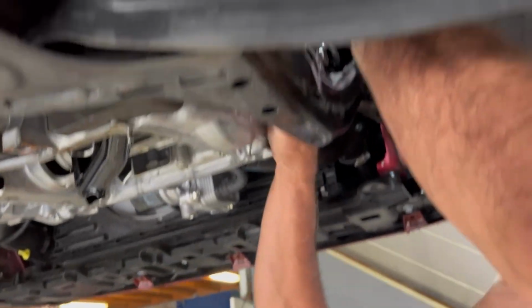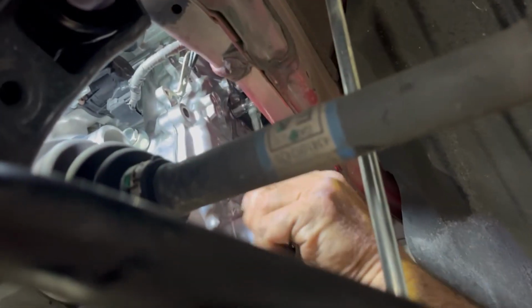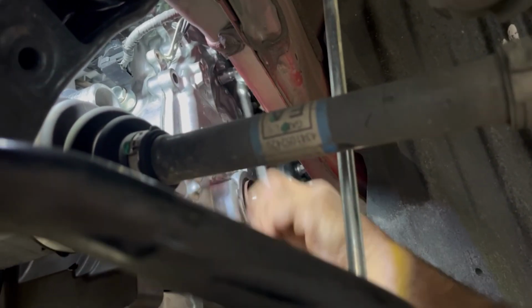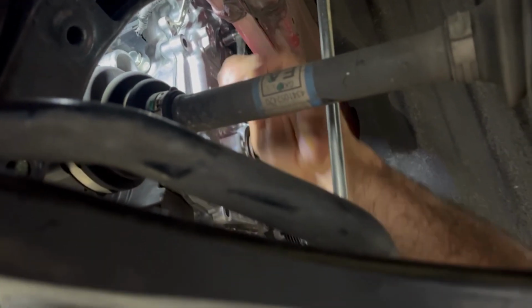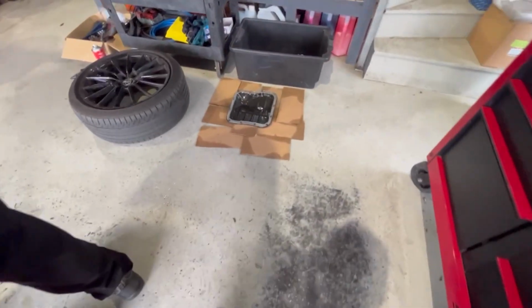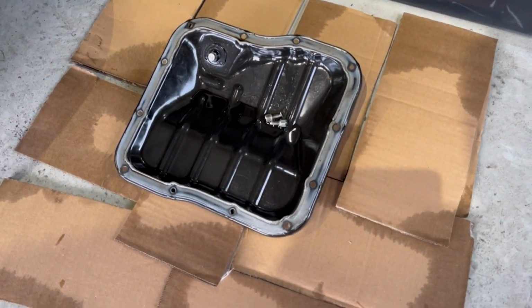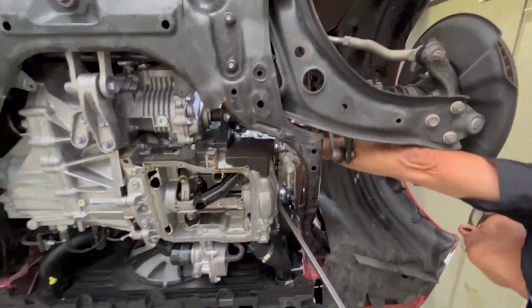So you've taken off the actual bolts now, for the timing case. It's going to take out all of it. I've got one left. Problem with silicone is, I've got the sump, and the sump's steel, pressed steel. It's probably going to splatter, but you've got to try to get it off without distorting it. The silicone's that good. Have a look and see how well it's sealed. Just got to go careful here because there's an oil pump there.